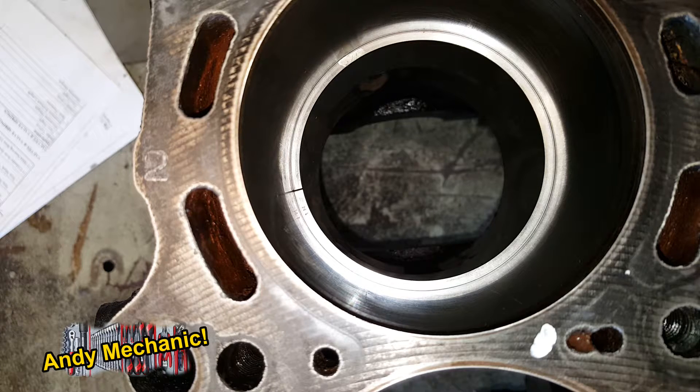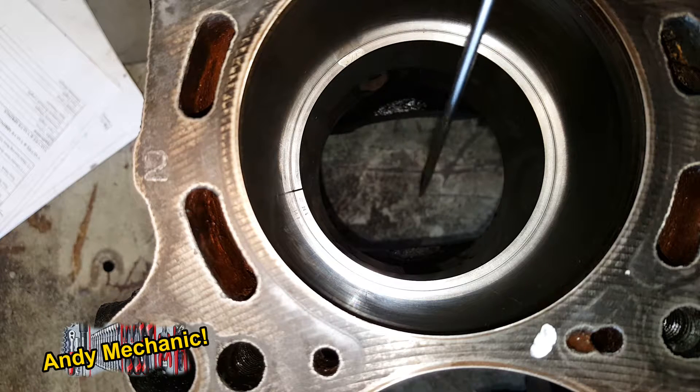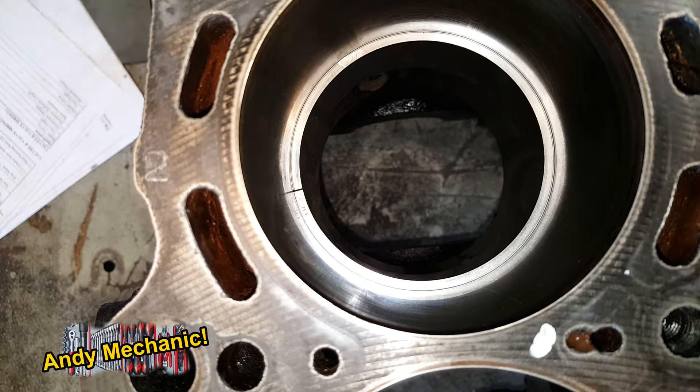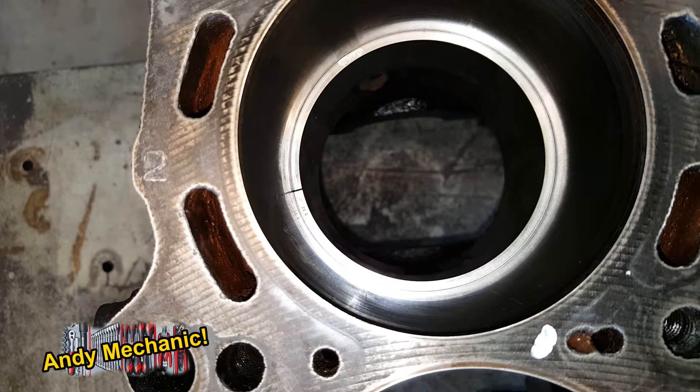What's going to change that gap is as the cylinder wall wears, that piston ring is going to spring further out — its diameter is going to increase, and of course that gap will increase. Also, the contact surface of the ring against the bore will wear too, which will also increase that gap. Specifications: end gap for ring number one — standard is 0.27 to 0.5 millimeters, and the wear limit is 1.1 millimeters. That's quite a lot, so it's definitely smaller than that.